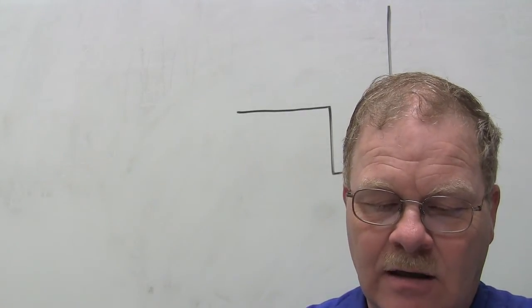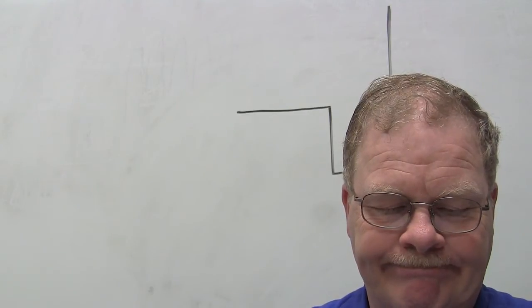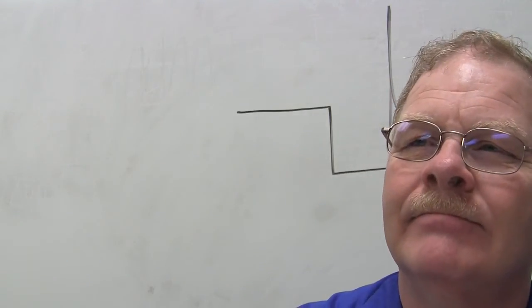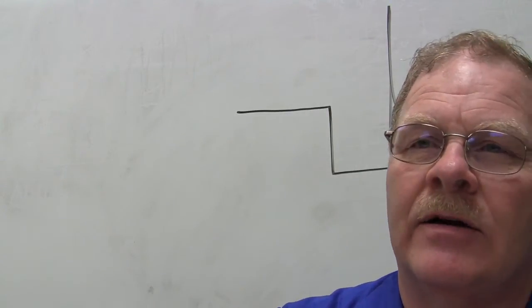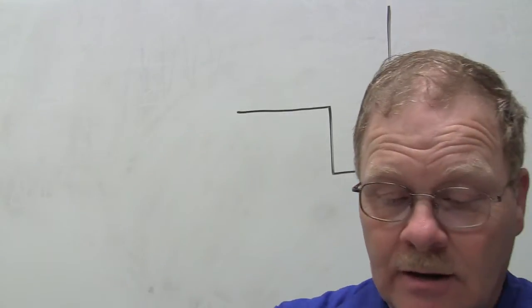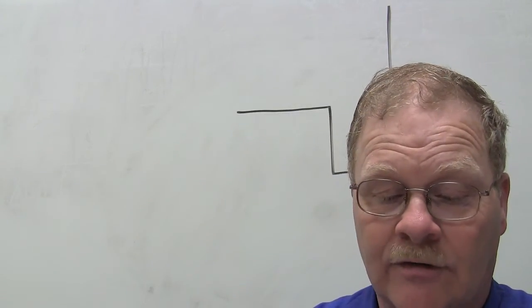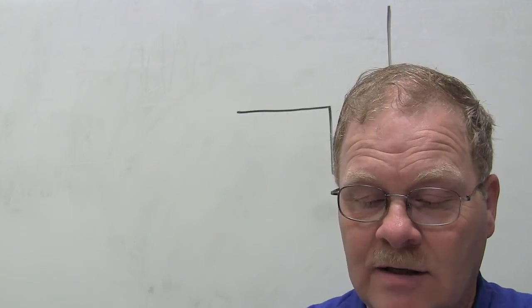Technician A says a PCM reprogrammer requires the use of a special battery charger. That's true. You need one that won't ripple. I've got a $550 Midtronics battery charger that I use when I'm reflashing a PCM, and it's a little small thing, but really important.